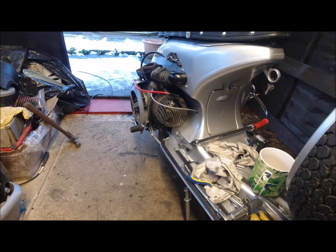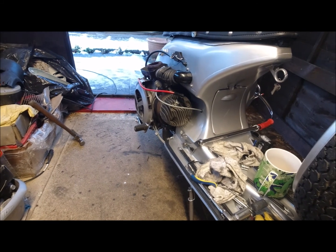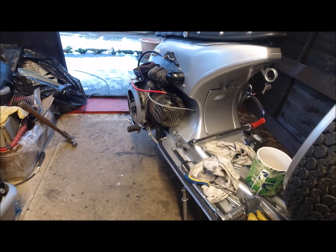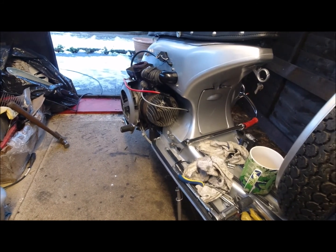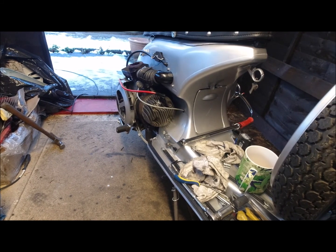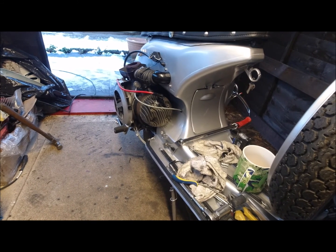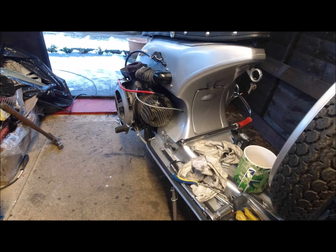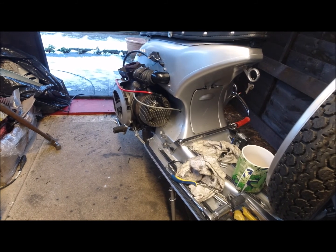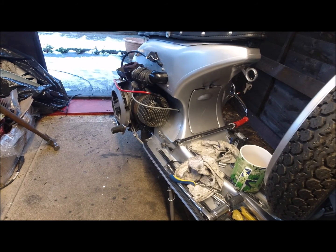and the front brake binding slightly when you pull it on, they are SIP brake shoes in there, brand spanking new. Back ones are just Piaggio ones, not the SIP sort of compound ones. The reason for that is when I ordered the set from SIP, they sent SIP ones for the front and Piaggio's for the back for some reason. I don't know why. Maybe they'd run out of stock, but the ones on the front are sintered, and it is a really good front brake, to be honest with you. It's probably miles better than most standard drum brakes on a Vespa, but we'll get there.